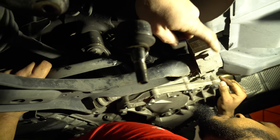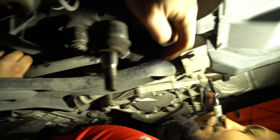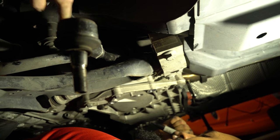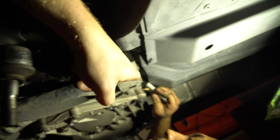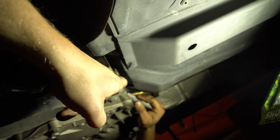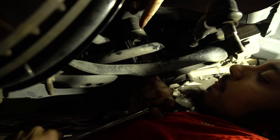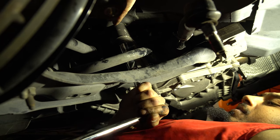When you're going around your subframe and looking, this bolt right here is going to be loosened off, this bolt right here is going to be loosened off, and that one — same with the other side. There's going to be six in total. What you can do is go around to noticeable spots on your subframe and take a sharpie to line it up, because we want to make sure it lines up in the exact same position. It's an 18mm — we're just going to break some of this tension off. The breaker bar is the best invention ever for this stuff.